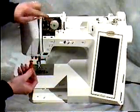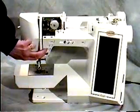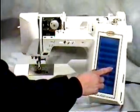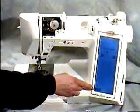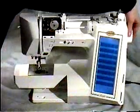Open the 1 through 40 test mode screen by holding in both the start, stop, and reverse buttons while turning on the machine. Select test mode number 25 and using the plus or minus keys, reset the screen to 00. Select close and turn the hand wheel 1 full turn to reinitialize the tension motor.